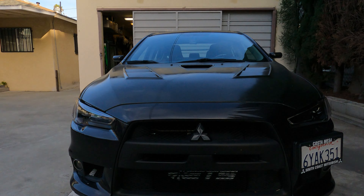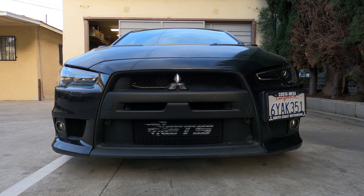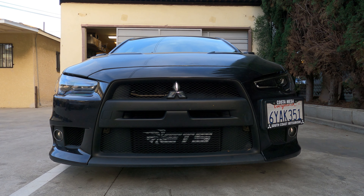Finally done. I'm going to dress up the car and then I'll show you guys the result. After a long day of work, I finally finished installing the ETS intercooler and the intercooler piping. I'd say this is one of the harder projects, so keep a whole day planned ahead just to install this. For me it was a 4-inch ETS intercooler and I think there was a problem with fitment. On the website it says there's no modification needed, but if you take off the crash bar and then install the intercooler and put it back, then it works. But if you want to slide it up, it will not work. Look how it looks guys — that looks awesome. I installed this because not only does it look cool, but it cools down the engine a lot quicker and hopefully makes the engine last longer.